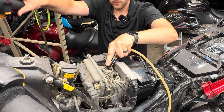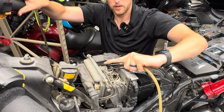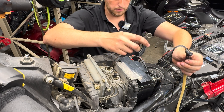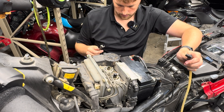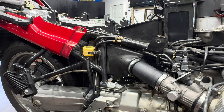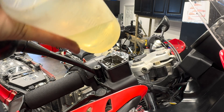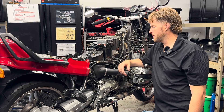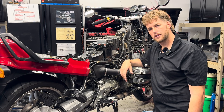Hopefully this video helped you out. If it did and you're not subscribed, please subscribe to my channel — it means the absolute world and it keeps videos like this coming. Get the bleed valves closed, replace the rubber caps, fill the reservoirs up, and take this thing on a test drive. Thank you so much for watching my BMW ABS bleed tutorial — please subscribe and as always, have a safe ride.